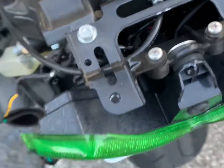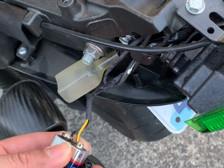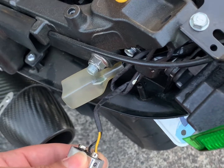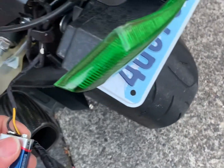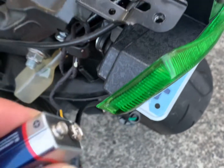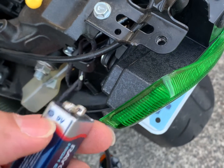And your kit might come with a different color scheme or different wiring. What I did is basically grab a small 8 volt or 9 volt, sorry, battery, and this is not going to affect the LEDs, so I just hook it up to these, and if you have it the wrong way, on the wrong side, it will not work. This light will not light up. Okay, if you flip it and it works for you, then you can tell which one is the positive and which one is the negative, and you go from there.